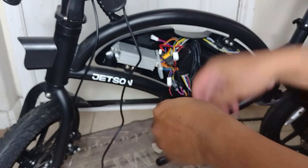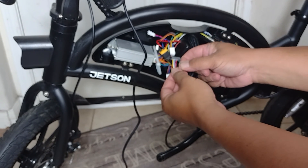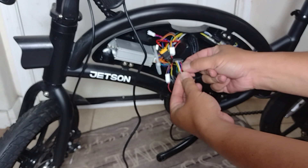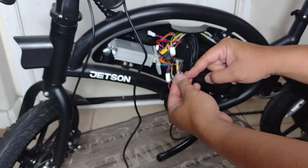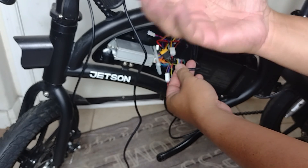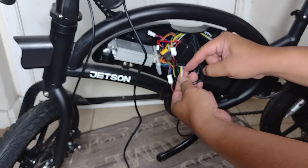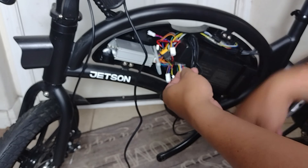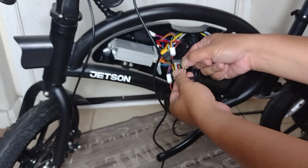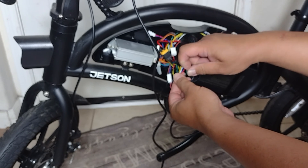After trial and error, the only wire you need to cut is the green wire, if you have the same wiring diagram as mine. Cut the green wire, tuck the wire going to the battery and controller, then connect your green wire to the white wire of your new throttle. For the black wire, just strip it a little bit and connect your black. For the red, don't cut it — just strip it and connect your red.